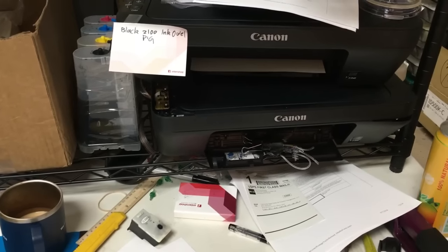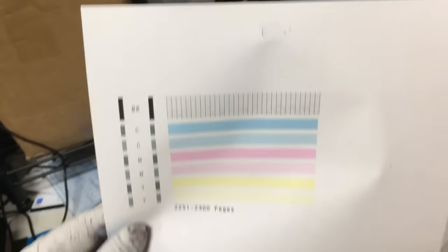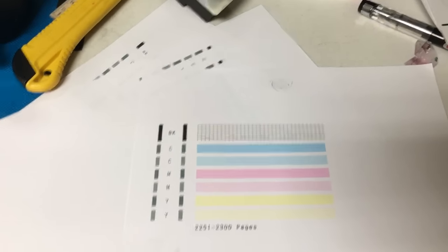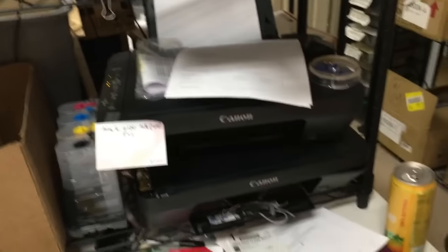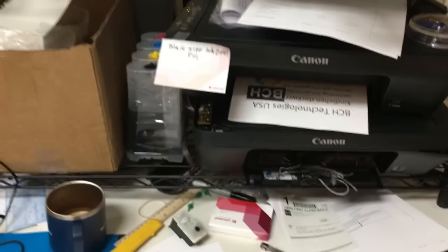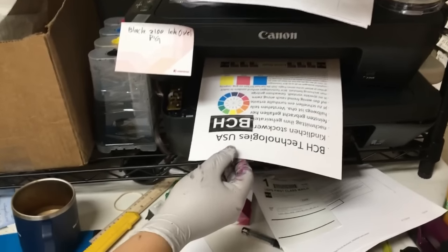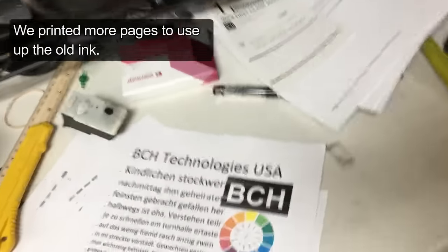The process is complete and we also need to print the check pattern — it'll give you a test print. Let's see Rebecca's first refill. It's only about half — so just like we said, half is clogged, half is not. You can see the lines. So we'll take this out and unclog it a little bit more. The one we soaked is already unclogged — you can see the difference between water and the actual cleaning solution.